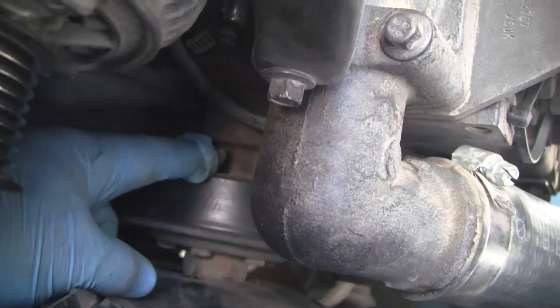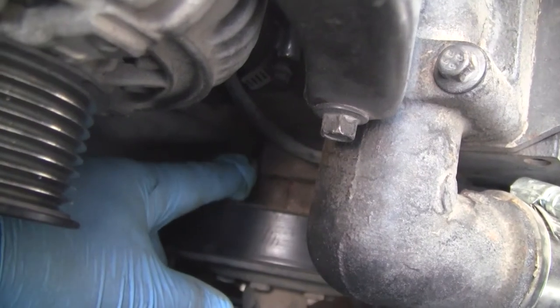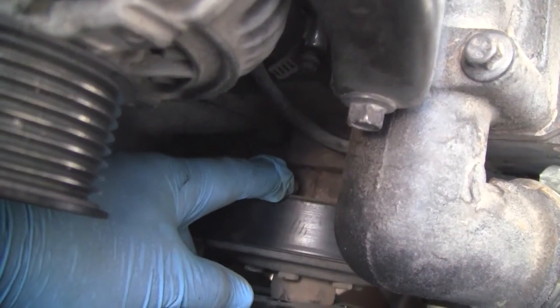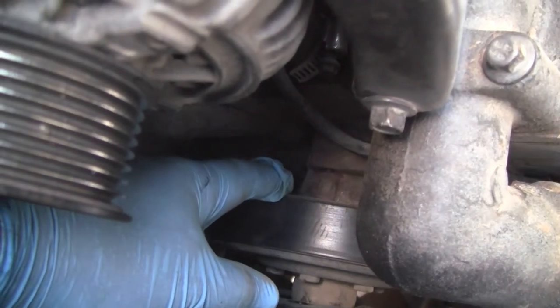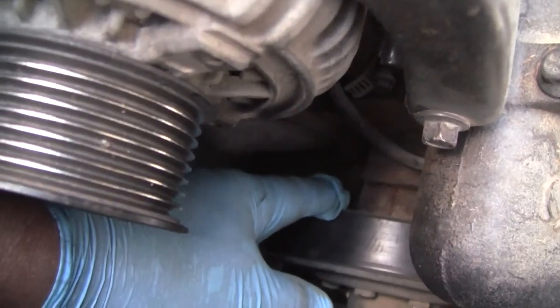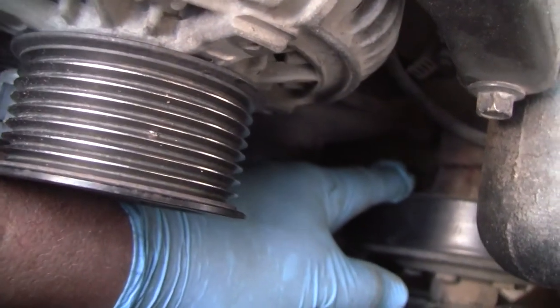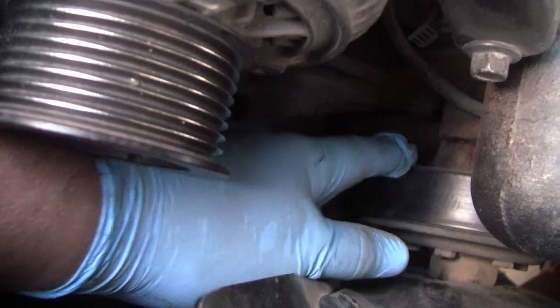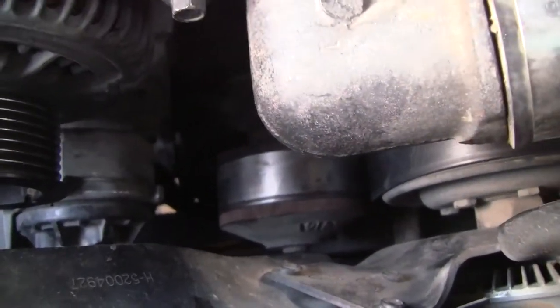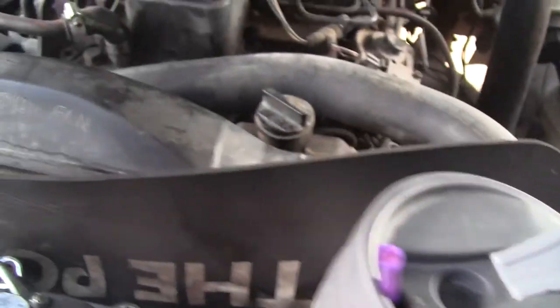The bottom one — right above my bare fingertip there — has to go completely out until it hits the back of the pulley. Then you start pulling it downward by pulling on the wiring harness for the crank sensor. I thought I was going to have to take the pulley off, but it pulled down, angled, and came out — it just barely makes it. Work it out gently. Those two things — loose fan and idler fully extended with no belt tension — made it possible.